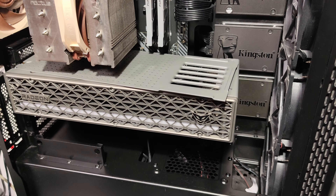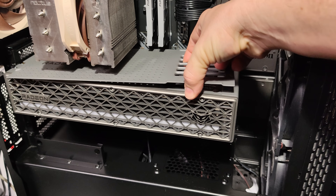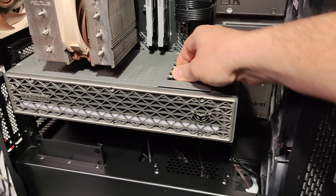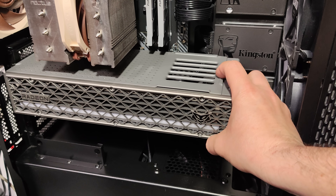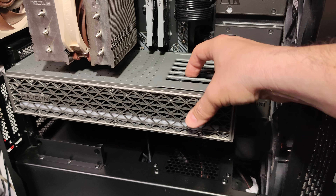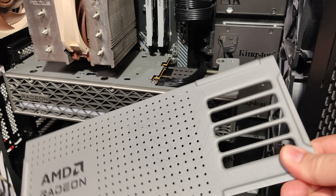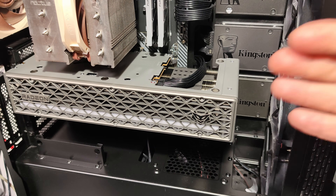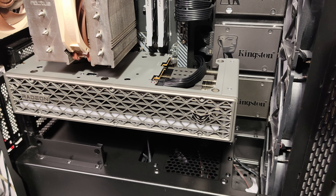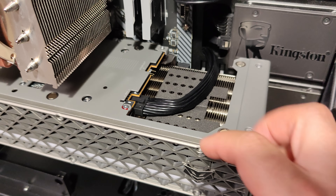This backplate is just a nice-looking thing that doesn't even stay in place — and it can hit your motherboard. Because of that connector pushing it up, it's floating in the air and not making proper magnetic contact. It can easily slide away from an external shock and contact your motherboard, and when that happens, they are not going to exchange four numbers — they are going to exchange your bank account for a new motherboard.